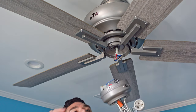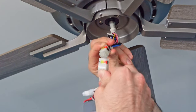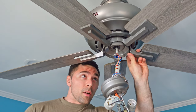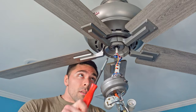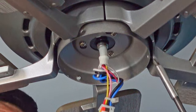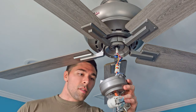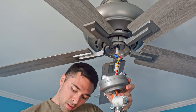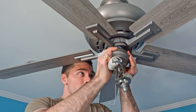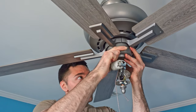Now I take this part — there's our wire, we've got our plug. We want to match up the colors on the plugs. It might be a little hard to see because the fan blades are probably in the way, but I've got three openings on the outside of the piece I just put in — one, two, three. Same thing on here — I've got three screws and we're going to secure this in place. Feed the wires in a way that allows you to not pinch them as you put this in place.